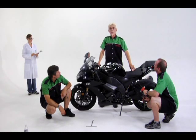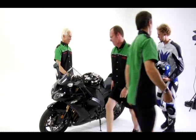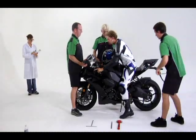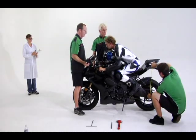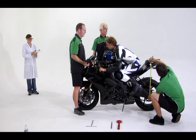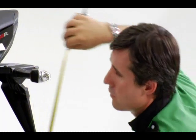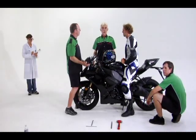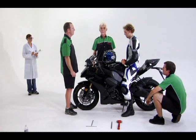Back on with the rider and remeasure this sag. It does its bounce. Good. It settles. We remeasure. You come up with 589 millimeters. Okay. 589 millimeters is exactly what we were looking for, and we've got 30 millimeters of sag in the rear. That's perfect. Good.